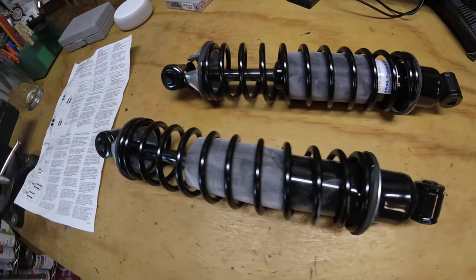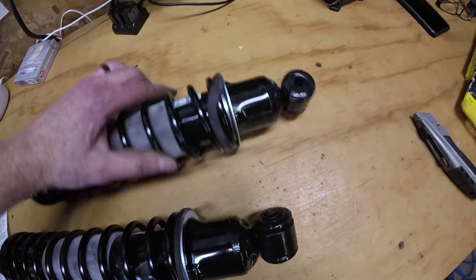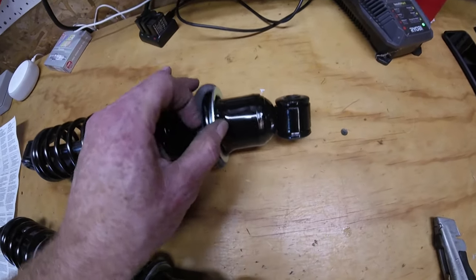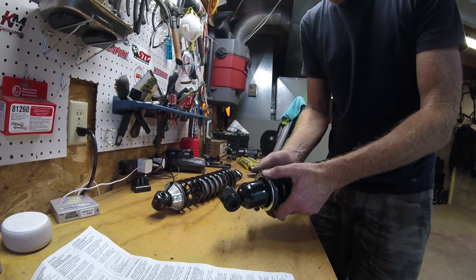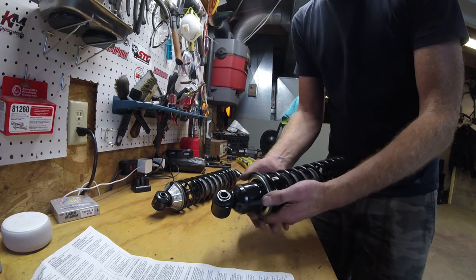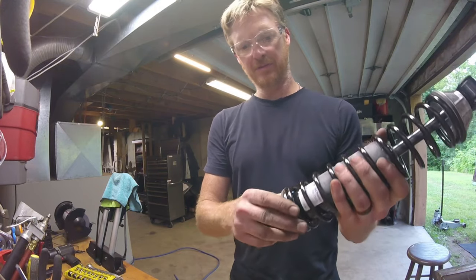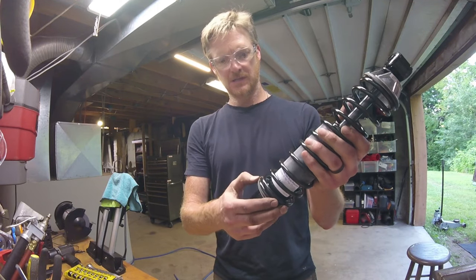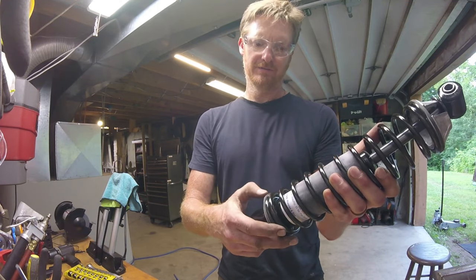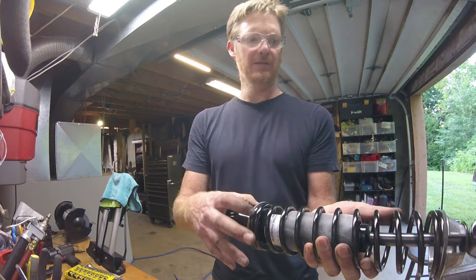So this is them out of the box. Got a little issue here already, I can see. Some of the reviews about these shocks talk about squeaking. This little rubber thing was loose when I first opened it — it's not in there very hard. And it's not very hard rubber. This might break, wear, and then you end up with metal-on-metal contact.